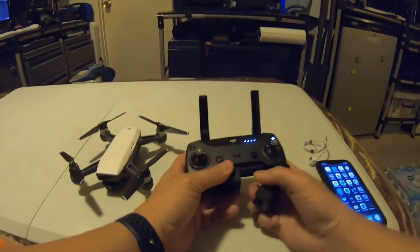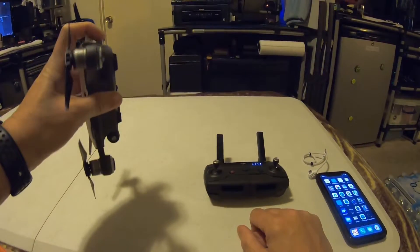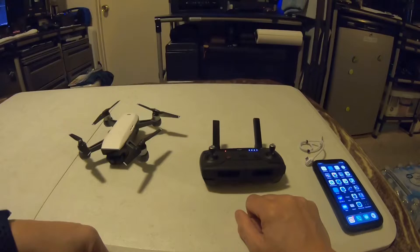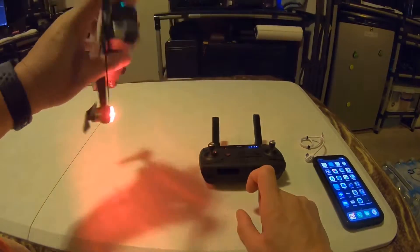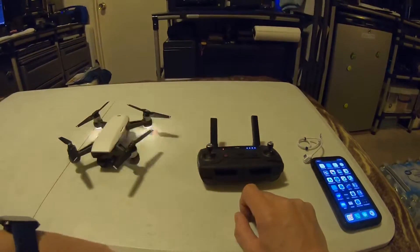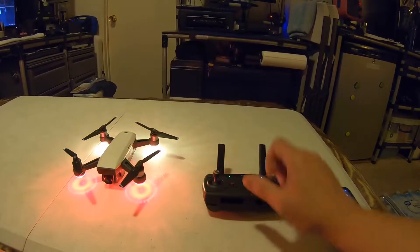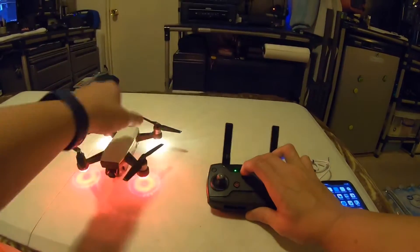In my setup I'll be using an iPhone — Android is similar with maybe a little difference. So, power the remote on first. Press once, hold down a second time until it powers up. Then to pair it, hold down the main button until you hear one beep and let it go. I'm indoors so it paired a bit slower than usual, but that's how it works — that's how you pair it.